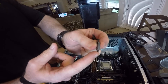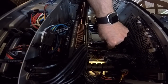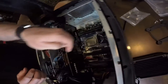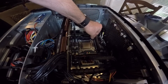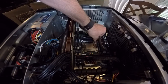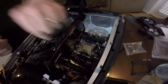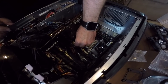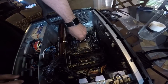Instead, what you need to do is use the appropriate offset screws for the 2011 socket. The ones you want are the only ones in the box where one end is fatter but much shorter than the other — that's because your socket has larger-sized threaded screw openings. Just snug these down using the fat end into the four large threaded holes. If you use the wrong mounting hardware you could potentially damage your setup, so make sure you check your socket type. If you don't have the Aurora R4, the kit includes several different bracket types for AMD and Intel.